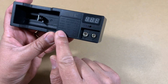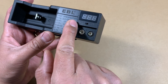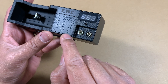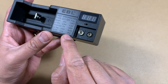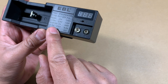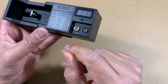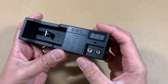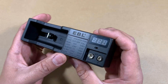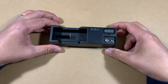One nice thing to point out is that since it doesn't do the green/yellow/red indication, it gives you a chart. It has a full chart so if you put in a battery that's supposed to be in good condition it should be near the full number. For a 1.5-volt battery like a double-A or triple-A, you're expecting a 1.5-volt charge, and if it goes around 1.0 volts that's pretty much the cutoff — anything lower has to be discarded. A lot of people think if a battery is at 1.0 it still has some juice, but the reality is below that cutoff it's going to be no good, so that chart is actually very handy.